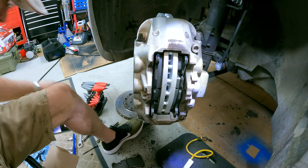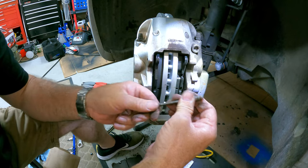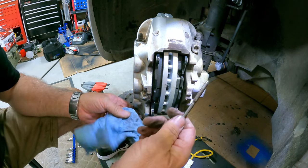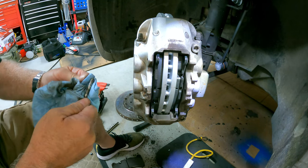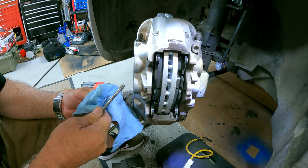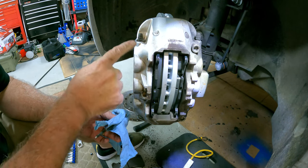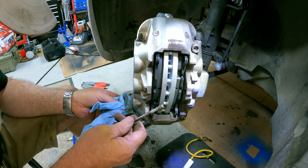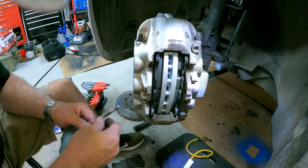Let me look at these — I'm going to clean these up a little bit and put just a little bit of brake lube on them. The reason you put a little bit of lube on there is because the pads will move a little bit, and if you've got a little bit of something on there it'll keep them from squeaking, hopefully. If they do start squeaking, I'll pull them back apart and I've got some stuff that can go on the back side of the pads that'll help with that too. Let me go grab that stuff and put a little bit of that lube on there.